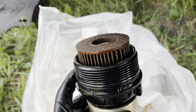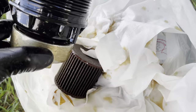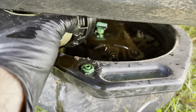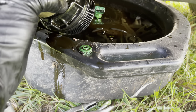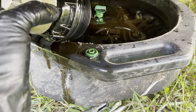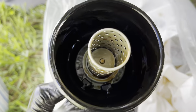All right, let's pull it out. You can see the element — a little bit of oil, that's what a dirty element looks like after some time. Drain the housing by tilting it all the way down. This truck is awesome because you don't even have to lift it off the ground to do any of this — most other cars you do need jack stands.